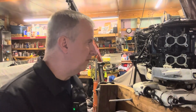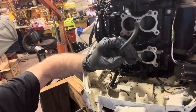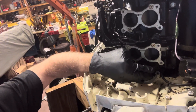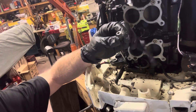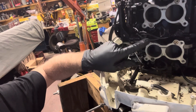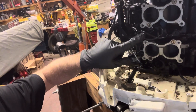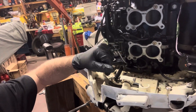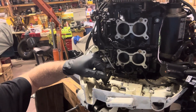Let's take a look inside here — we want to check a few things. This is the tube that goes to the air box, and someone commented that could also be leaking. There's oil right here because that's where it drains down the bottom of the manifold. We're going to make sure this fits on there all the way and put a good tie strap on it. Then we have our bleed lines — went through all those to make sure they're good. I scraped the old gaskets off. We won't be putting any sealer on this — these will just go on like that. Let's get these carburetors on.